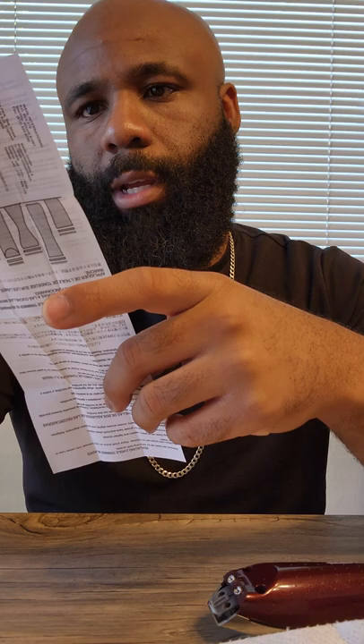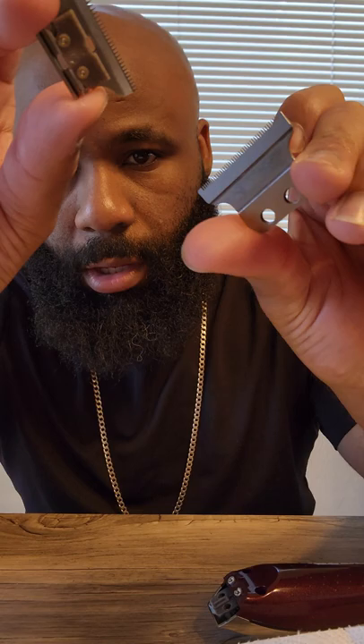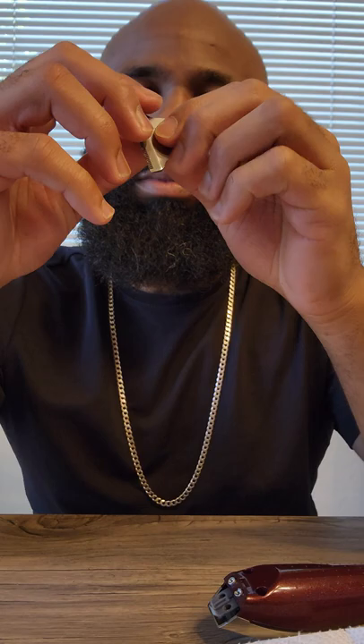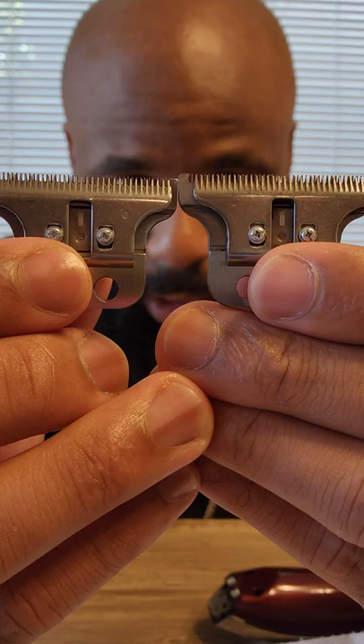To remove the blades, hold firmly and push away. Before replacing the blades, make sure the two spring wires are seated in the notches and that they move freely. So we got one end right here like this, the other end like this with the gap in the middle - you want to kind of put the little thing in the gap. Once you get it in there it slides, as you can see like that. It looks like it's zero-gapped pretty much already. Let me compare it to this one - they're about the same.